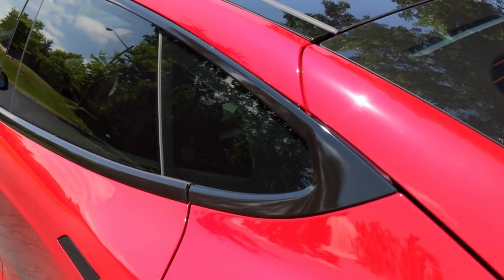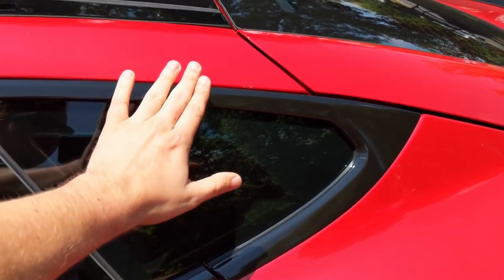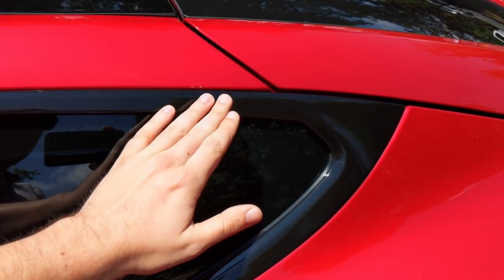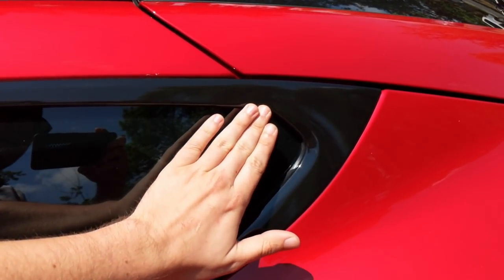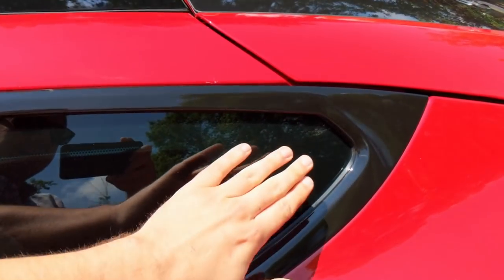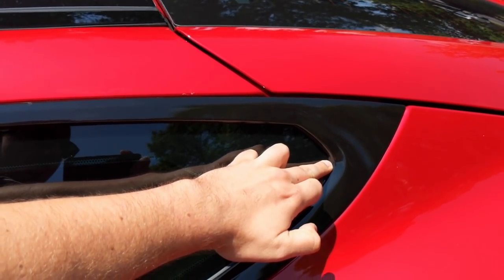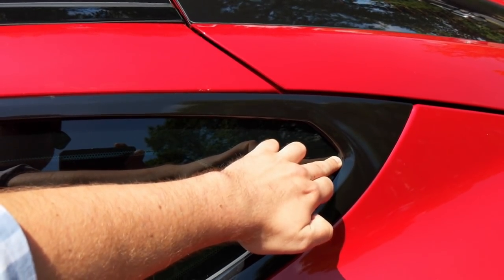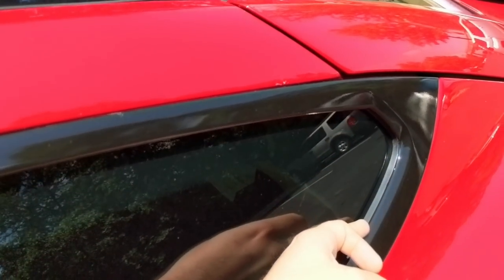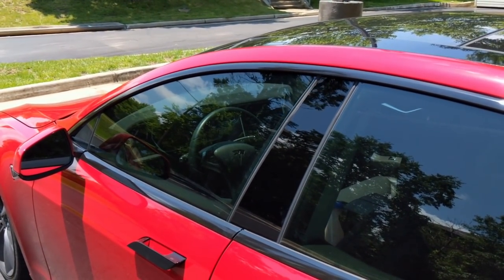Use masking tape on the edges so you can really tuck in. I have an extra eighth of an inch of vinyl wrapping all the way into those edges because I was able to tuck it in really good and then come back with a sharp knife and cut off all the excess. Here at the front edge, it can be tempting to take your big piece of vinyl, wrap across the front, and then try to stretch this edge in. Instead, I would come across here, get it on this edge first, then stretch it over. If you try to wrap from the top edge and wrap down, this edge gets really stretched and can have pullback. Take your razor blade right on the inside — there's a nice groove you can easily get into.